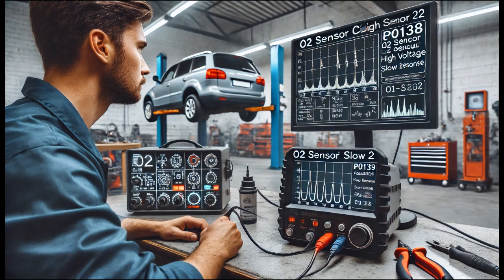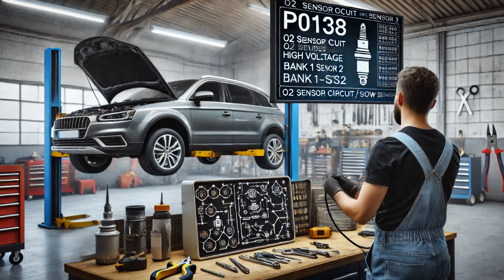Next, I created a large vacuum leak to simulate real-world conditions while monitoring the oxygen sensor B1S2 parameter. Despite the leak, the sensor reading remained fixed and didn't change, which further indicated a problem with the sensor's ability to respond to changes in engine conditions. To test further, I induced propane into the intake manifold to see if the oxygen sensor would react. The sensor voltage remained the same, confirming that the sensor was malfunctioning and not responding to changes in air-fuel mixture.